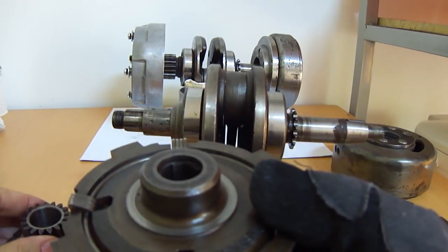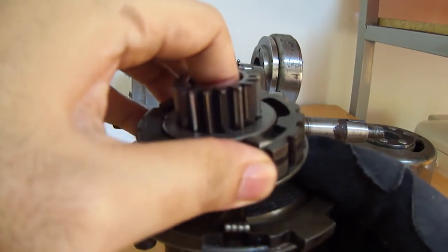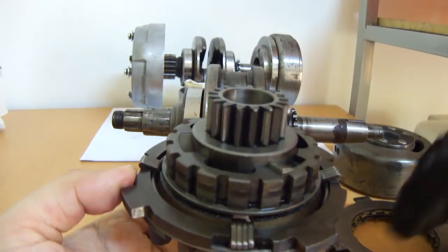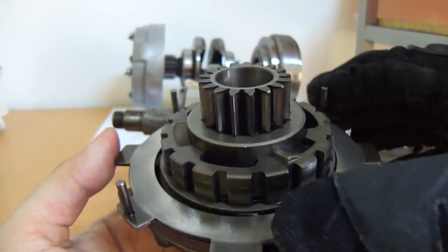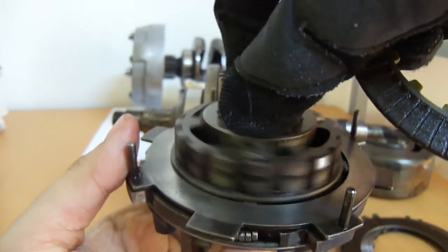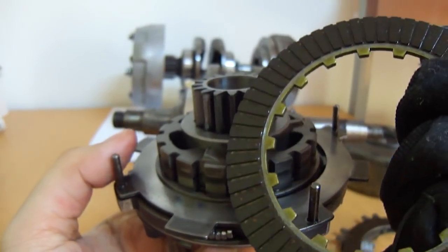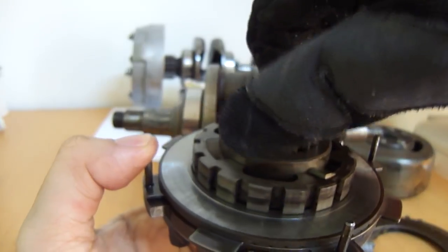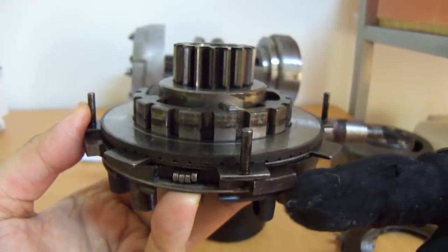Let's take the spindle and pick up the drive gear assembly. Put it on there — you see it's still freewheeling. But now I'm going to start putting on the clutch disk. This disk does not attach to the spindle at all, but it has teeth in it and friction disk material. That material is going to go down on top of here. This is the basic principle of how we are going to join this gear to this spindle. The spindle is connected to the crankshaft, and this gear is freewheeling.